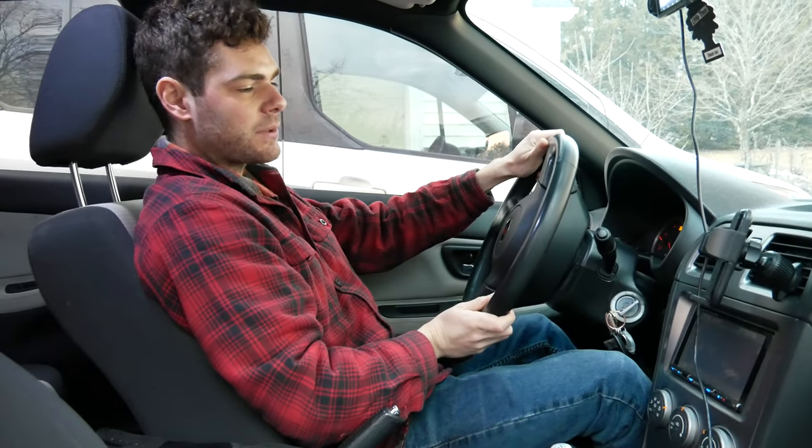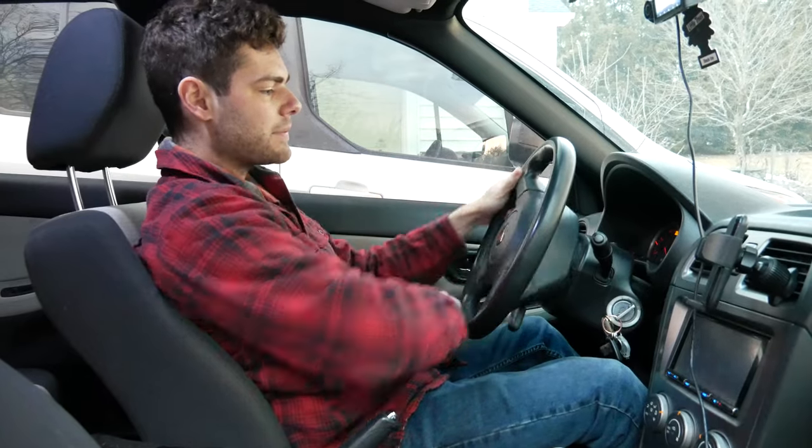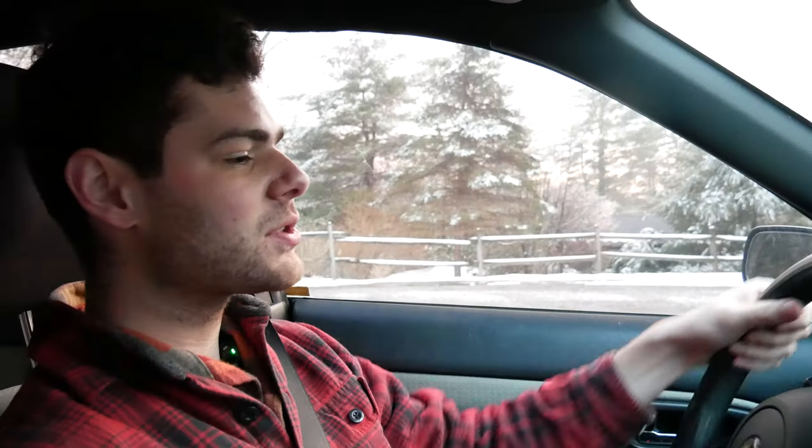On the way back, there's a hard spot at the end of the power steering — actually I felt it sort of free up there. I'll go back and forth a few more times, let it sit for about five minutes, then repeat. The wheel is still binding up a little, so I'm doing some circles to see if it starts to clear up. Keep in mind this is a cleaner that takes time to break down debris in the rack. If there are metal shavings, you should flush your fluid, but if it's just debris, this should do the trick.